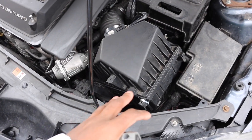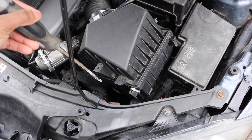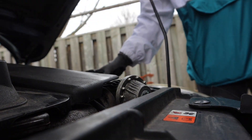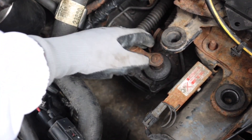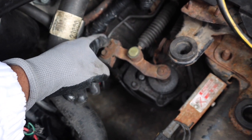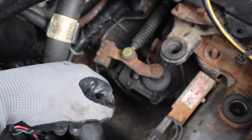The great thing about this install is that it's super quick and easy — literally takes like 15 minutes. You're going to remove the air box on the intake, and then it's literally right under there. Now that we've got the air box off, here's the linkage. We're just going to use a flat head to pop this off and then unbolt these — I think these are 12 millimeter sockets. We'll just take those out and pop that off.